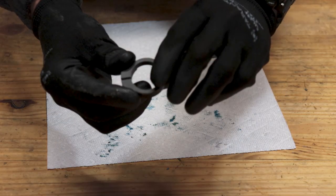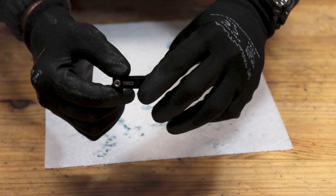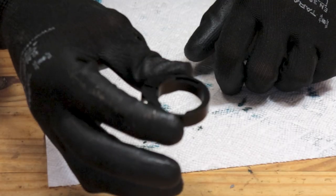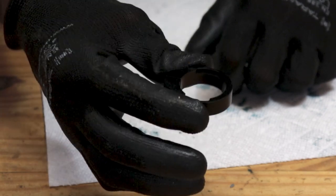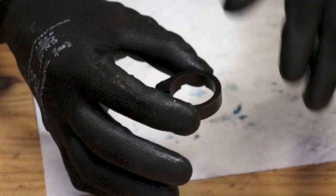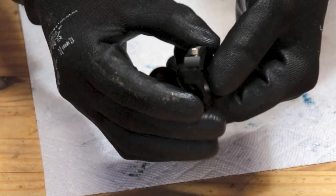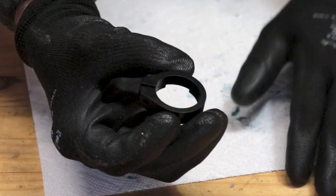Here's the part — I finally got it in. It's basically a 10mm spacer that has machined notches that engage the knock block top cap. I'll put this on underneath the stem, set the preload of the headset bearings, and once that's set I'll snug this down to 3.5 Nm and then snug up the stem and it should be good to go.